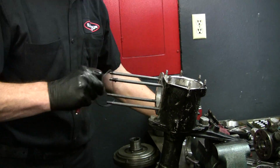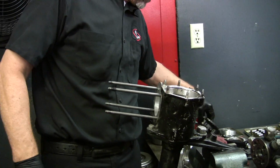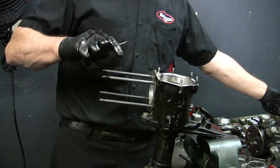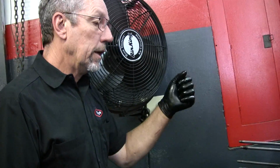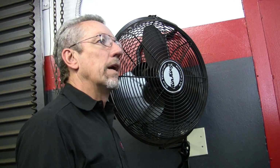So once this is all together and you go to adjust it, these big nuts at the end with the washers way out here have to be loosened. You can adjust it in the car. Then you have to tap this with a mallet until you get the right feel. I like to have it so that when the steering gets to that center point, it gets ever so slightly tight. Remember that by the time you put that big steering wheel on the end, and you've got those big tires out on the road and all the linkages in between, even the slightest amount of play will make a difference going down the road. So I like them a little bit tight, but not so tight that they don't return when you go around a corner. You've got to be able to let go of the wheel, and it should try to come back to center.